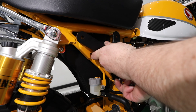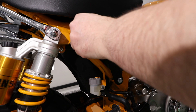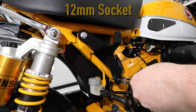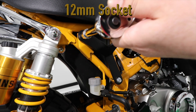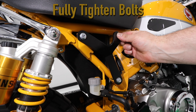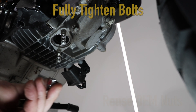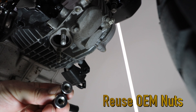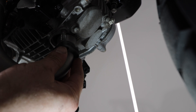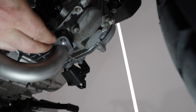The first step is to screw in the Y-shaped muffler mounting bracket — you can actually torque it right down and fully tighten the bolts. The next step is to mount the header pipe using the original OEM bolts, but just screw them in by hand for now so that you've still got a little movement and play in the pipe.